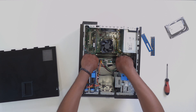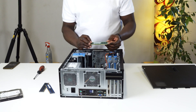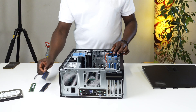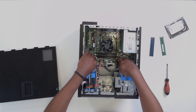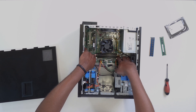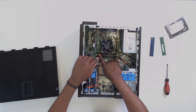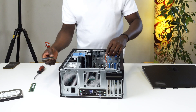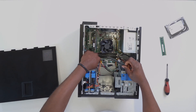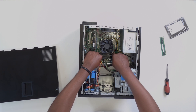This PC came with a 4GB DDR3 RAM, but as I said, we're going to be upgrading it to 16GB. All you have to do is push back the RAM holder and push in the new RAM until you hear the clip sound — that way you're sure the RAM is properly seated. The first stick is in; now I'm going to go ahead and push in the other one.